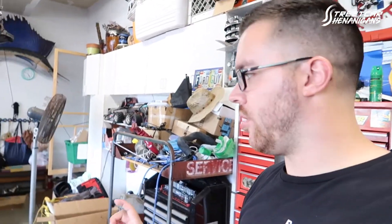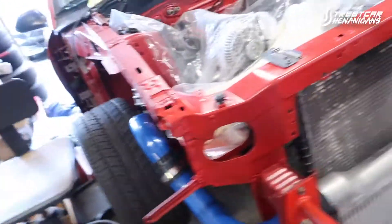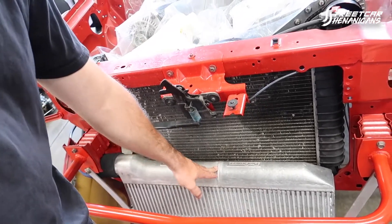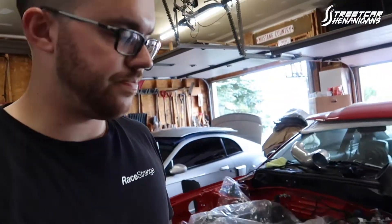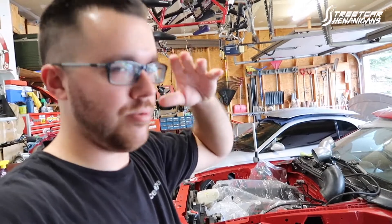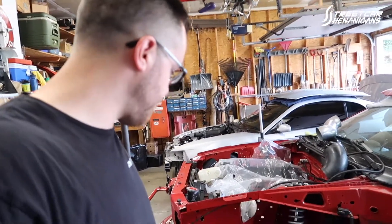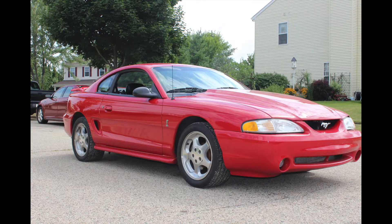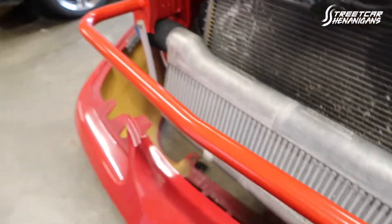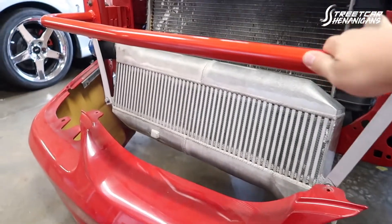What you probably haven't seen yet — I'll put another link up here — is that we have the 94 Cobra radiator and intercooler in now. This is ProCharge's cast aluminum dual-core intercooler. Nothing's really wrong with it — it's kind of undersized for the power we're trying to make, but we are running lower boost levels to get to those power levels. However, it just fits really weird, and it sits very crooked in the front grille because you're very limited with the inlet and outlet placement.